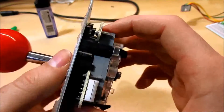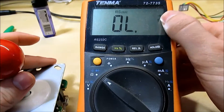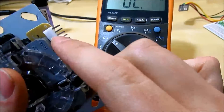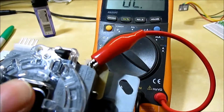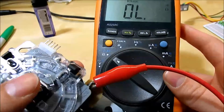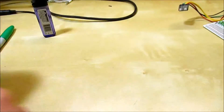You can verify your joystick is functioning using a multimeter. Set it to resistance mode with an audible cue for a closed contact or near-zero resistance. For a Japanese-style arcade joystick you need to know the pinout of the Molex connector, or you can wire directly to the contacts of the individual micro switches. As I trigger this, you'll hear the multimeter sense the closed contact.